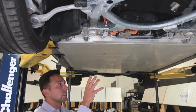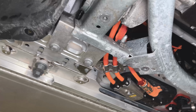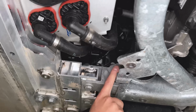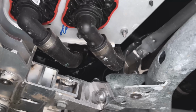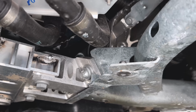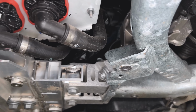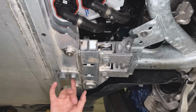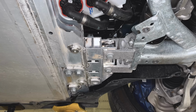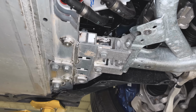The other thing that I see with this subframe being attached to the battery pack is you'll notice a very distinct ramp-like feature at the upper trailing edge of the subframe. Typically those are not on accident, and also they're typically not for decking or installation of the cradle. Ideally, if you look at all the other bolts in the area, you would mount directly in the Z-axis, so everything's perpendicular to your ground plane.